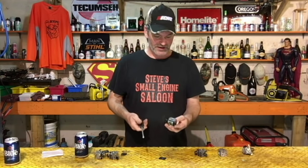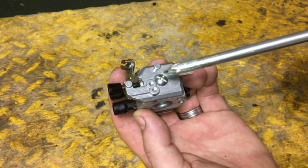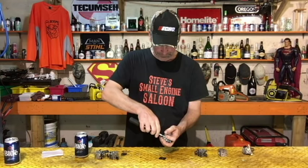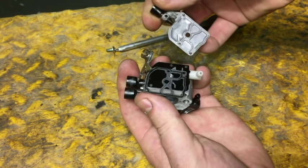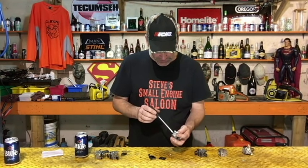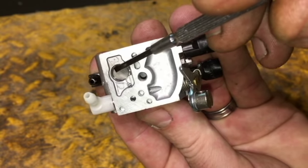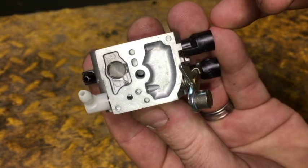Since you already have a carb kit and the other side of this carburetor is so easy, let's do it. This is your fuel pump side — just one screw. Take that off. There's really one thing to check here: there's a little screen down in here, and if your fuel filter falls off, you can get a lot of debris sucked out of your tank that will pool right inside this little hole on top of that screen. Just look at that quickly and make sure it's nice and clean in there.